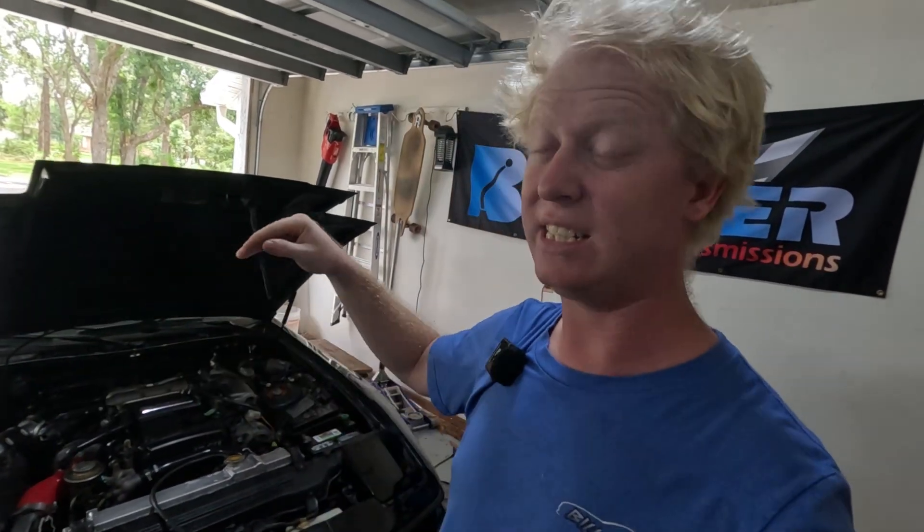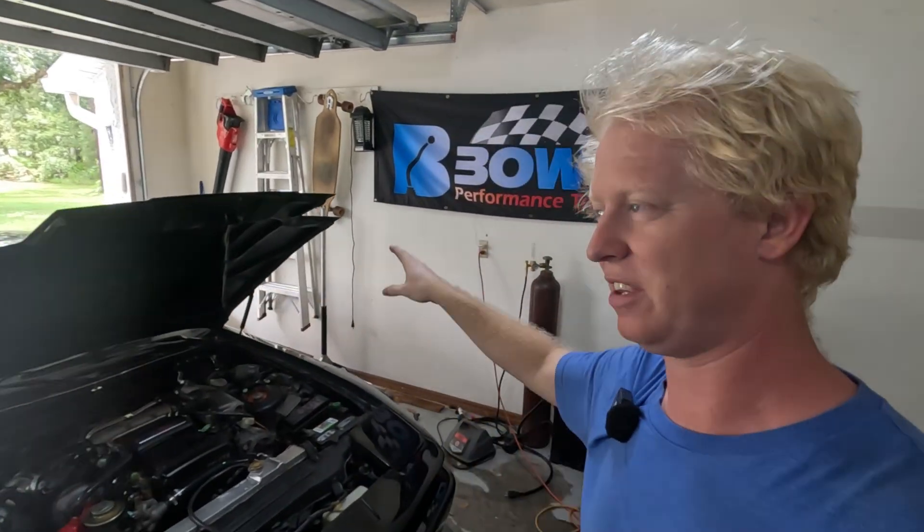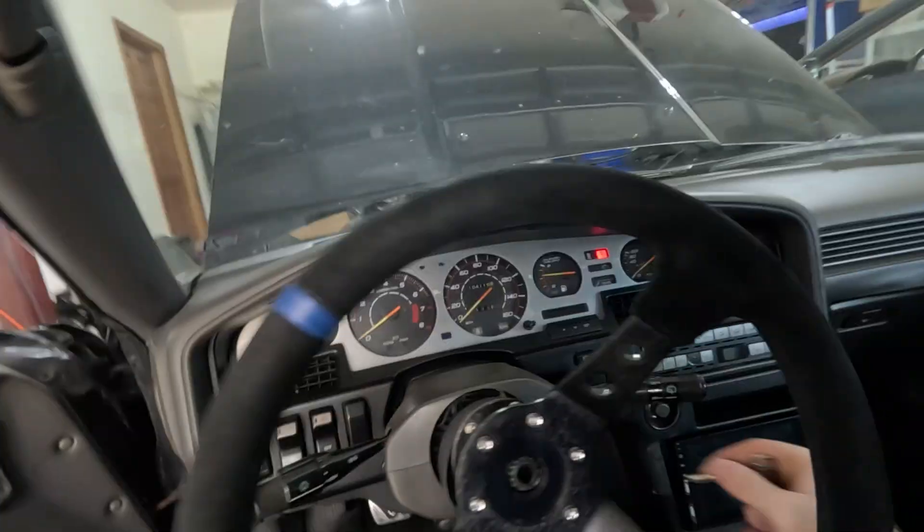What I'm most curious about today is honestly just how the 7M in the Mark III Supra is going to sound in its factory form, because I've heard anti-lag in the 7M before — just not in a factory turbo, pretty much stock 7M. We're still on the stock fuel system, stock fuel injectors, still batch fire fuel injection, 100% factory fuel pump, lines, everything — even the factory fuel filter. I should probably change that. But with all that said, I'm going to hook up my laptop and go through all the settings to get everything set up for the anti-lag.